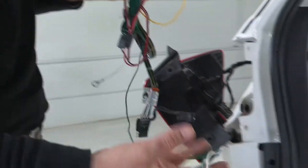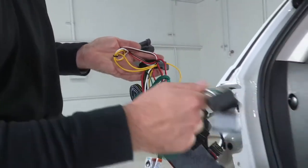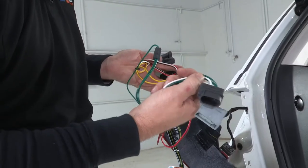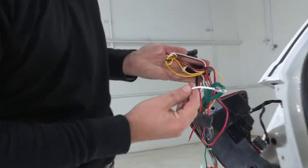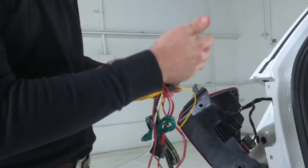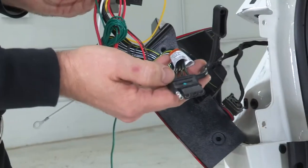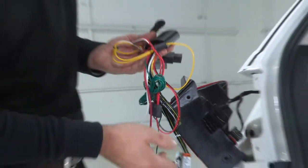We also have a green wire with a good length to it that's going to allow us to come across the other side of the vehicle and connect over to the right side. The green wire has an 'R' on it, telling us it's going on the right side turn signal. We also have a dedicated ground and a power wire. Since we're not taking power from our vehicle's lighting circuit, we're actually providing power to our trailer lighting through a dedicated source, so it doesn't add any significant draw to that circuit.